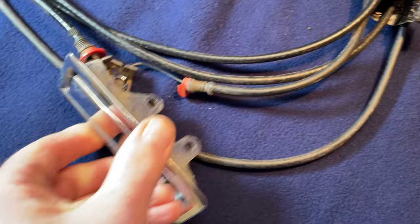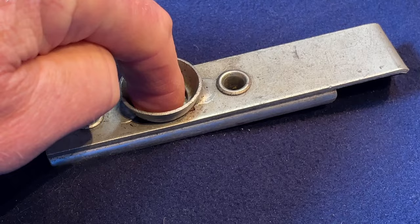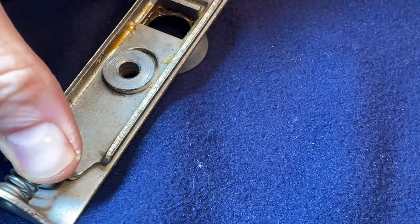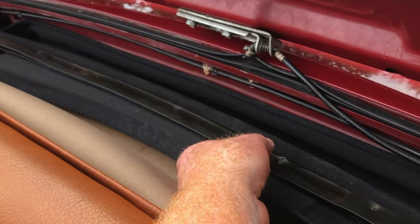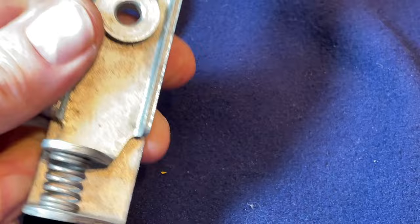You can see how you can easily swap over the Bowden cables, and I need to get some new ones obviously. In the middle of the tonneau cover itself you've got this latch into which the striker from the hood — convertible or hard top — goes through: a very simple mechanism, but operated by a separate Bowden cable. It's located at the back of the car, and all it does is move a plate over the hole. If you look through the back of the car on the outside you'll see a cable that pulls that slider just out enough to release the notched striker.